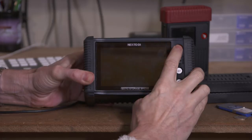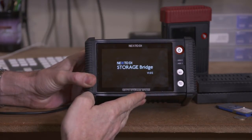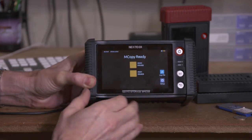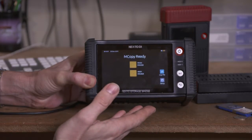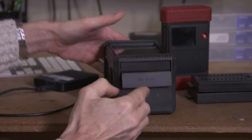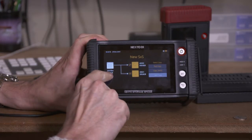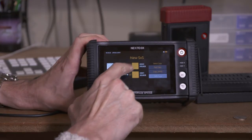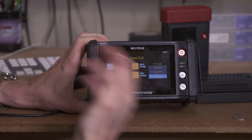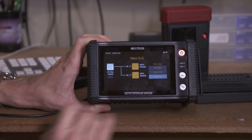Very simple unit to use. Power it up by pressing and holding the on button, and after about five seconds the unit comes on. It runs a quick self-check to make sure everything's okay, then shows the status of the hard drives. The two hard drives currently have 918 gigabytes of storage left. To make a copy, I take this SXS card and pop it in the unit. The device recognizes the media after a few seconds, and it's now saying it will copy 9.68 gigabytes of footage from the card to both internal drives simultaneously, giving me a master copy and a backup copy instantly.